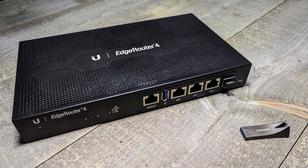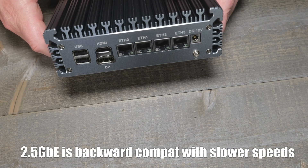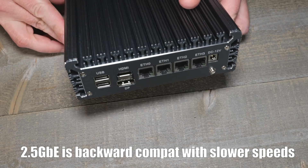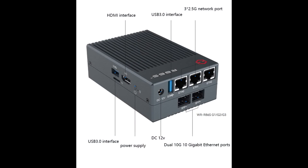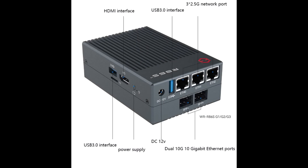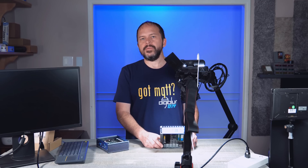Currently I'm replacing my EdgeRouter 4 — it's a Ubiquiti product and it's been a great router, but it only has gigabit Ethernet ports. This new unit has 2.5 gigabit Ethernet on all four ports. There's no SFP on this particular model, but I know other models have two-port versions where you can feed to SFP for 10 gig Ethernet. If you're routing that much traffic you'll probably need to go up in processor anyway.